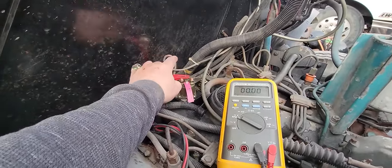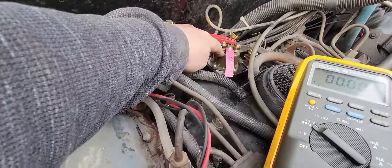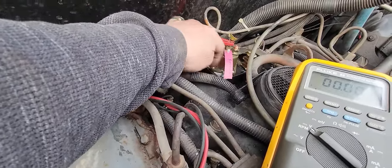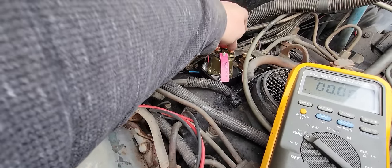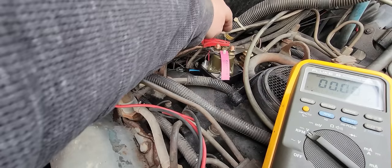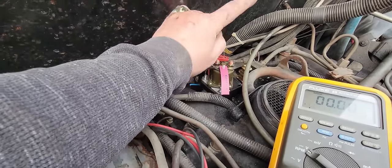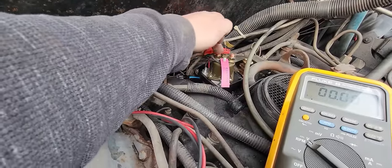We're just going to put in a push button in the truck. We're going to use this solenoid right here, and we're just going to rewire and eliminate that module. We're going to leave the module there for our mounting, because that's how it's secured, but we're going to put our glow plugs on the load side, and we're just going to run ignition power to it. We're going to run a ground wire to a push button inside, and our battery line coming in here.